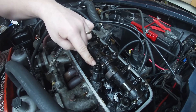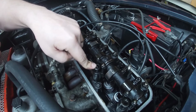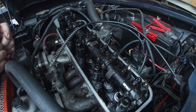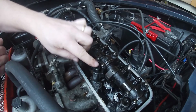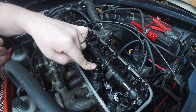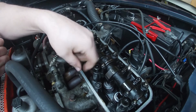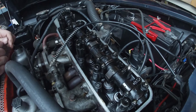These are hex head bolts, which are the stock bolts that came with this U20 motor. I think I am going to switch over to studs, which I've read end up being a little bit more resilient — you don't have to replace them. These bolts tend to stretch from what I've heard. So we'll change these out for studs that go in and nuts that go on top. Those are made by ARP, sold by a bunch of different places.